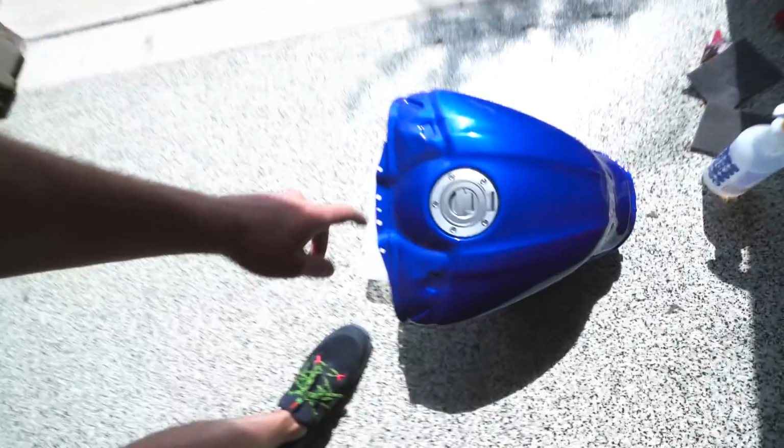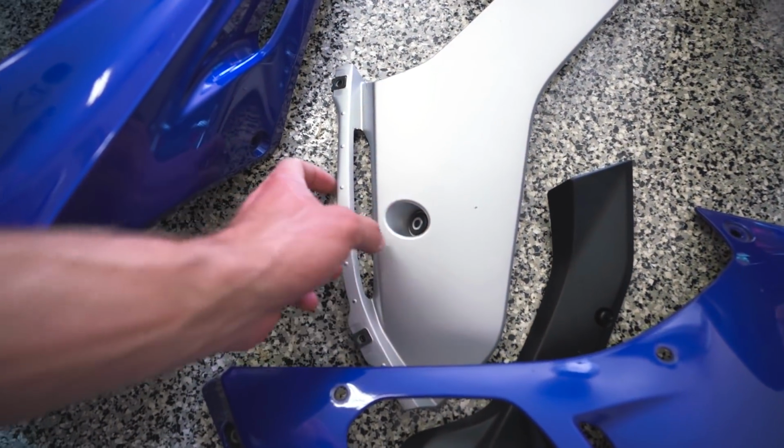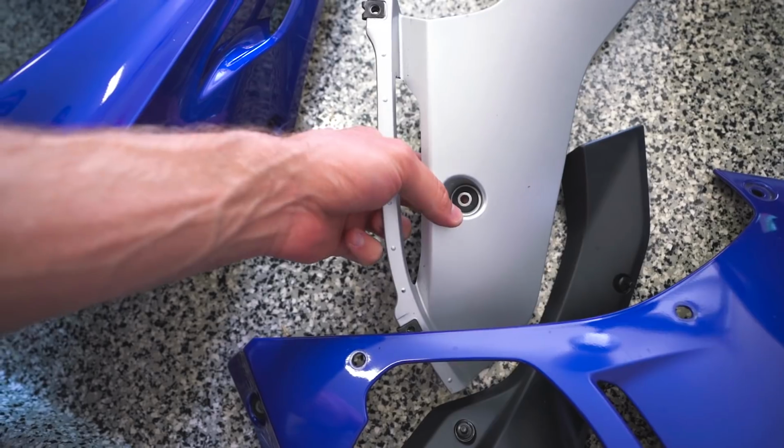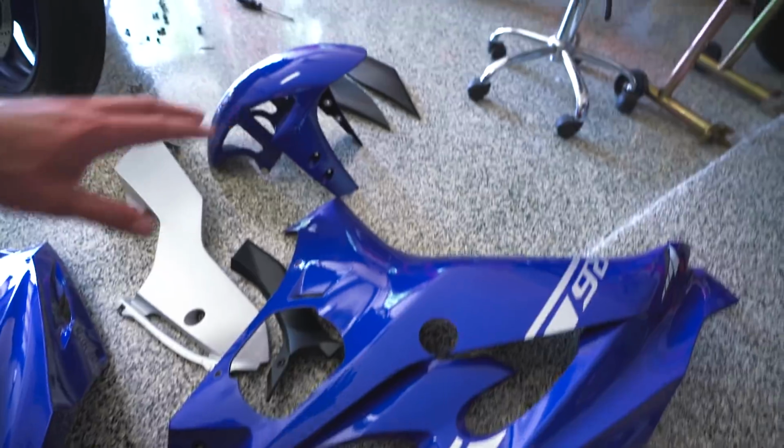Everything is not ready for wrapping yet. There's a lot of prep that I have to do. We're gonna do that in the video when I actually wrap this stuff, but we're gonna have to wipe everything down, get all wax and polish that I have on there off, just using dish soap. I also have to take off any pieces that are on them. So like on the tank, we have the fuel cap cover. These pieces right here, the rubber with the little grommet things for putting the screws through to mount these things to the bike. We're gonna have to get all of those things off. We're gonna get all of that taken care of in the next video for wrapping.